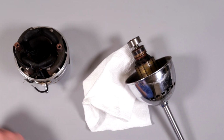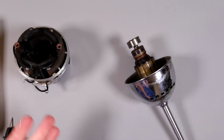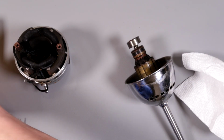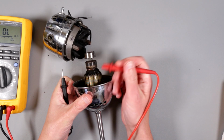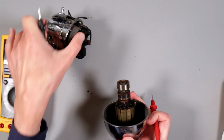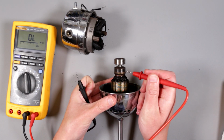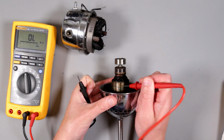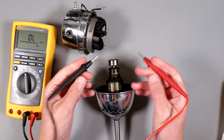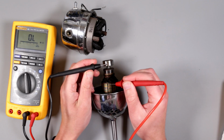First of all, we can try to measure inductance, which we can't do using this device, but I have something to measure inductance. Let's measure capacitance and resistance first. Let me move it a little bit closer. That's all dirty. First of all, let's measure if we have a short between any of these commutator pads and the armature. If we have a short between these, it's pretty much game over. This means it burned and it's shorted. Okay, first of all, let's check continuity.